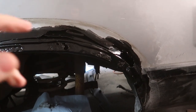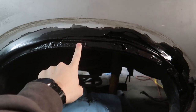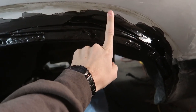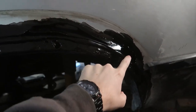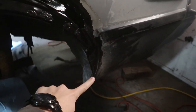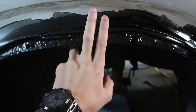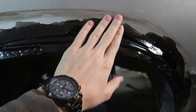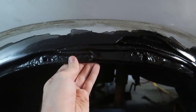It's the next day and I have two coats of POR-15 completely dried on the arches of the quarter panel. My next goal is to fiberglass this opening and make sure no water is getting up into these gaps or this hole right here. Otherwise from the hole down is good. This stuff came out really really nice — POR-15 is awesome. It's all really solid so I'm not worried about it. Let's go mix up some fiberglass.